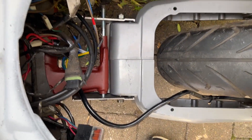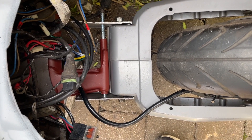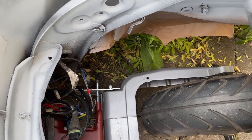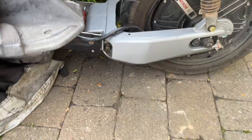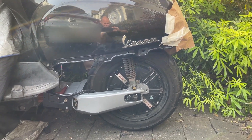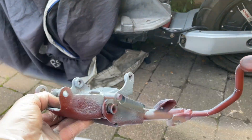I fabricated a temporary bracket out of some spare aluminium sheet and a piece of wood. It fits nicely with about a two millimeter gap between the two swing arms. The different colors are because I've done some cleaning and surface rust treatment on the inside, and the same on the swing arm — that's just some temporary primer. I've got a bolt temporarily through the shock mount so that lines up well.